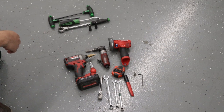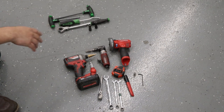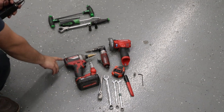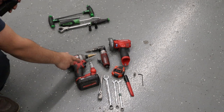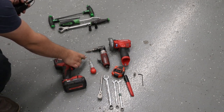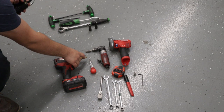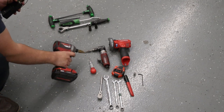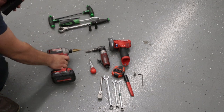Tools to install your splitter mount upgrade for the Toyota Supra splitter: you're going to want a stubby-ish drill to fit between the crash bar and the pedestrian mount. And then you're going to want a pretty short step bit that's got a three-eighths step pretty close to the beginning. This is an impact driver — stubbiest thing I could find, technically not the right tool, but it gets the job done.